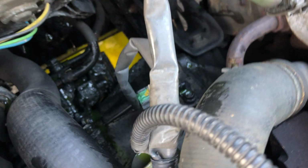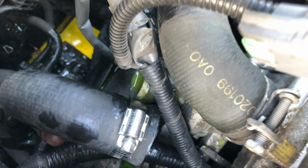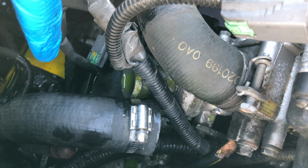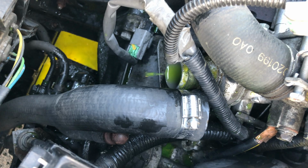Right now, I'm waiting for the coolant to drain into the tray below. You do not want to continue doing this until all of the top coolant is down there. And there's probably going to be more coolant coming out when I take this piece off. So I'm going to drain the little tray into a bucket. And obviously you should probably have some empty plastic cans to recycle this stuff. 10mm socket time.